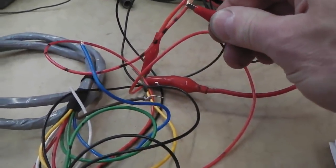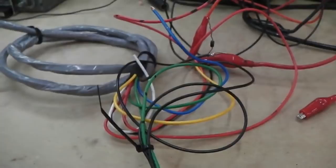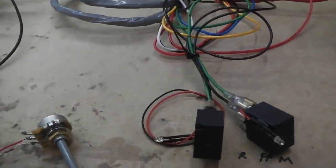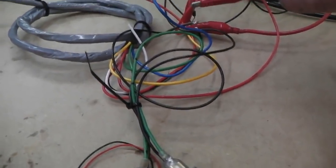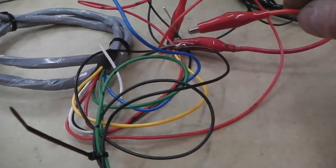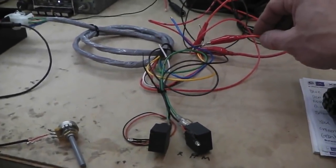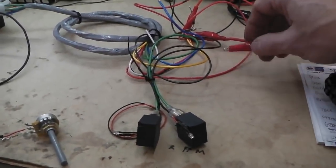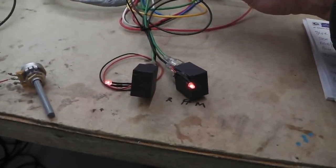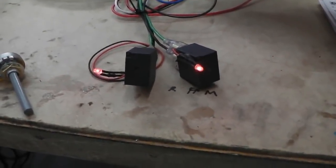So disconnect the power to it, simulating switch on the stalk that will fit. Now nothing happens, and now we're going to do our standard wash with post wipe delay. So that's just a foot operated wash now, 12 volts on this cable in your screen there. This is the wire for the wash, post wipe cycle. I'll trigger that, stand back for you. It pulses a bit there because I touched it on, but it's permanently on, so my foot's on, so I'll just get constant wipe and constant water jets going to the screen till I release.